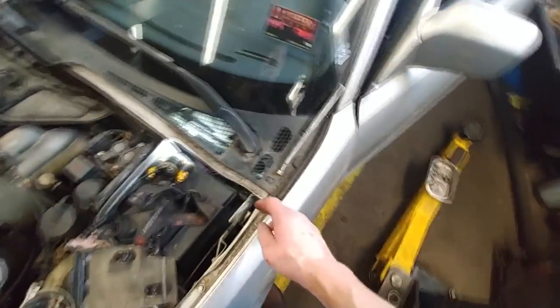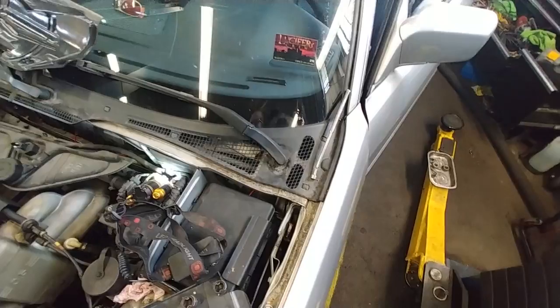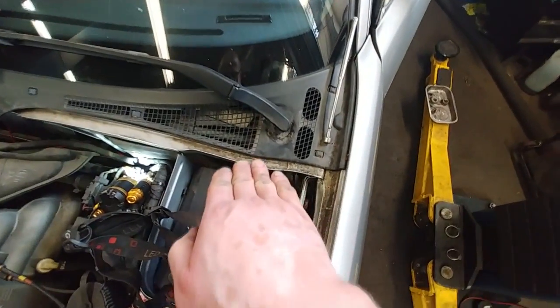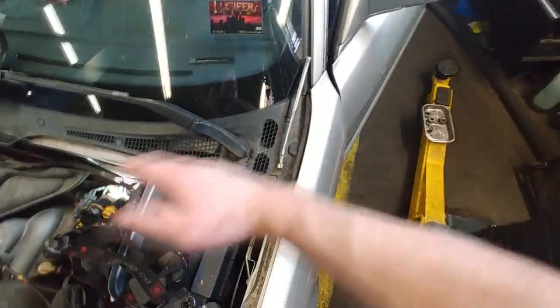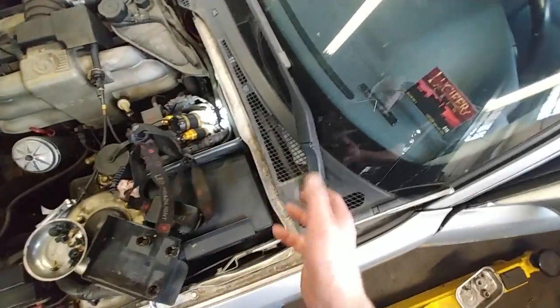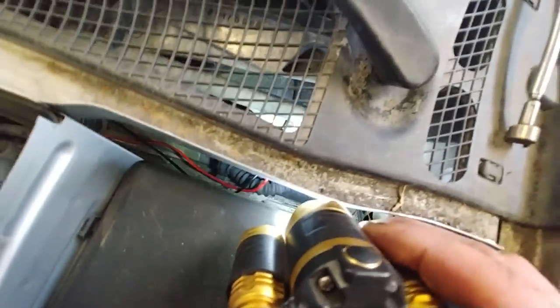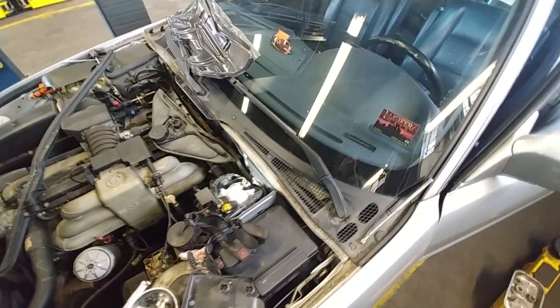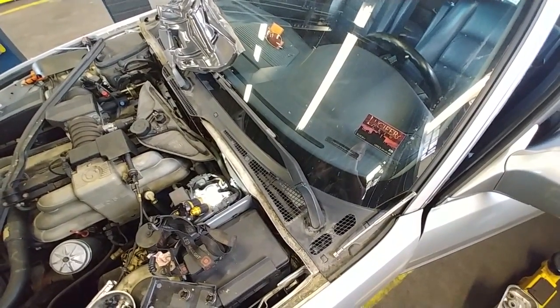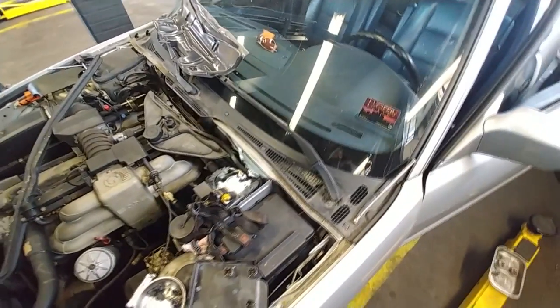It's not going to let any water in. On my other car I used a piece of plastic cut from a washer bottle — just pushed it in so that it covers the area, and any water that drops down will hit the plastic and run around the little wire. If you make the hole nice and tight you're not going to have any leaks; you can also put some silicone around it to seal it. Anyways, that's a nice upgrade for me. It doesn't affect AC — AC works as it should. All I did was make the motor run at infinite speeds via pulse width modulated signal. Thanks for watching.